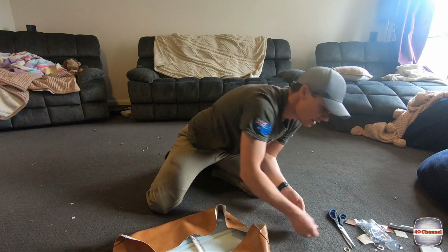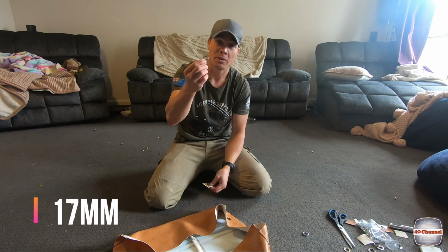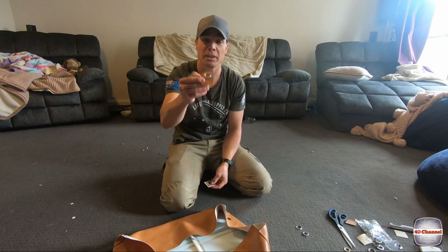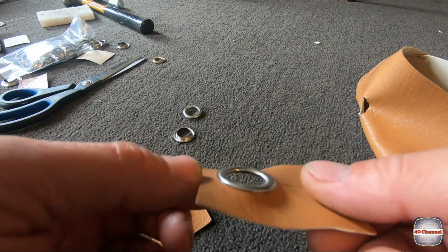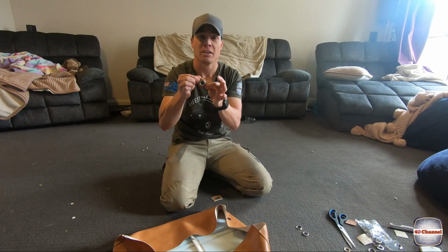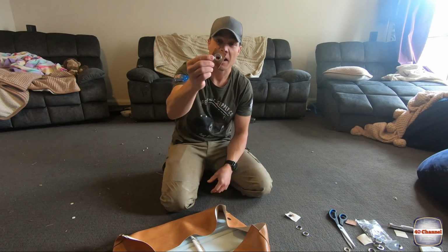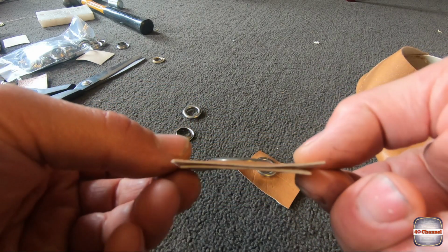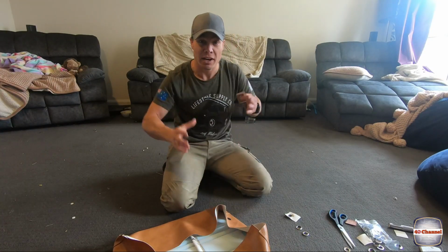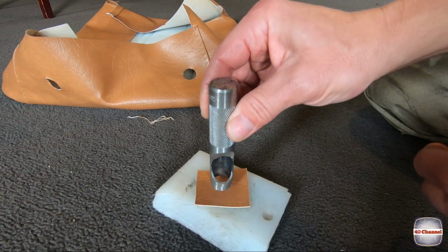And what we've done is we'll have to duck down to a local hardware supplier and buy the next size up grommets. The other thing we're going to do, as you can see, if you just put one grommet in with no backing, it actually raises it up a little bit and can damage that, and that's what's torn mine. If there's a little bit of stretch in it, then it's going to tear. So as Scott and I discussed on the phone, probably the best way to do it is do that, but then have an extra piece on the back so it gives it extra support. And that's what we're going to do. So we're going to be able to save these, plus it's going to give us a little bit of room around the headrest shafts and take away any drama or stretch. So we've got a 19mm hole punch here.